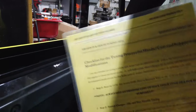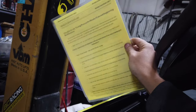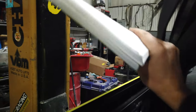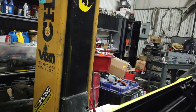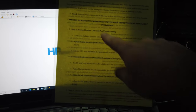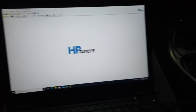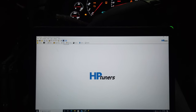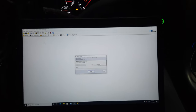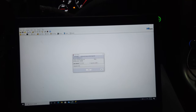It's a little dark here in the car but I've got my tuning school checklists. If you guys get the books from them I'd recommend it — I took the class, and this book walks you through everything. I've gone ahead and started on startup changes: idle adjustability, airflow, and spark. Made those changes, saved it, and now I'm going to write this thing to the ECU, give it a few minutes, and try it.